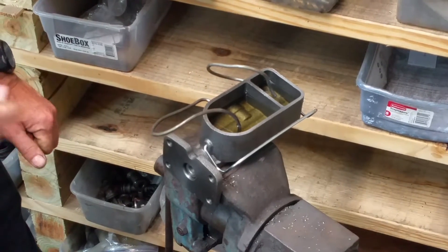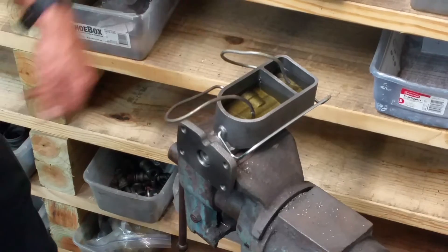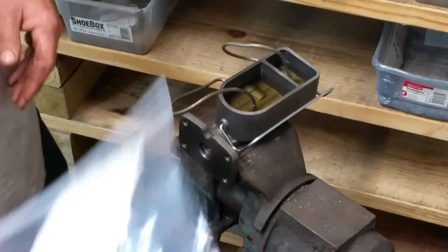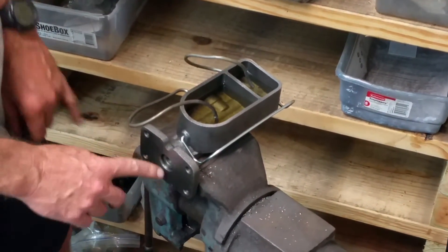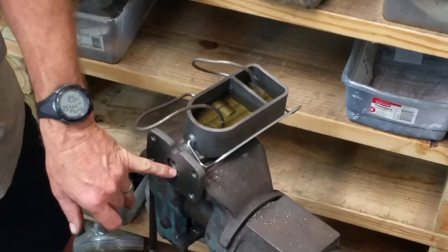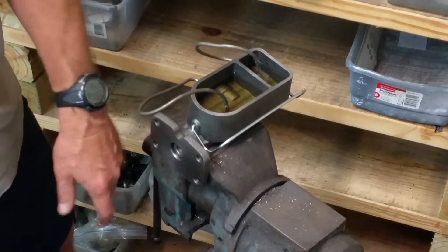Have we had some problems and little glitches? Very rarely with some others, yes, but not this one. It just says defective, so we don't really know where it might be defective. Lots of master cylinders, the seal goes bad and it leaks out of the back. This one's been sitting here with fluid in it for four days now. Obviously, it's not leaking out the back — no visual signs.